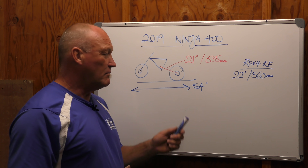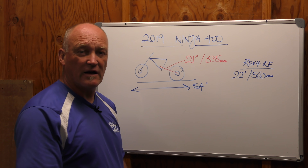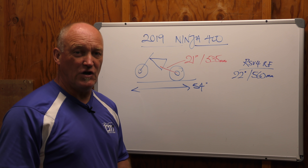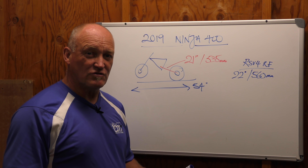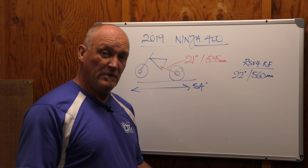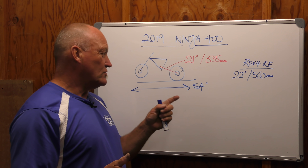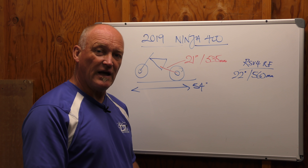A lot of people will go: I need to adjust my chain and I need to move the wheel back. In some cases, that's just a natural process of the chain wearing out and the wheel going further back. So the longer you make your wheelbase, the lazier the motorcycle becomes as the chassis gets longer. Many people refer to sport touring bikes as land yachts because they take a country mile to turn, versus a Ninja 400 that can start turning and disappear the other way extremely quickly by comparison. When you adjust your chain you're bringing your wheel further and further back. Sometimes there's a limit, and then the chain gets replaced because you cannot bring the rear wheel any further back. If you change your gearing to go to the track and you put a bigger sprocket on the back, that brings the wheel forward — and if you bring the rear wheel forward, you're going to get an even more agile bike.